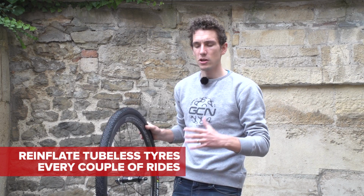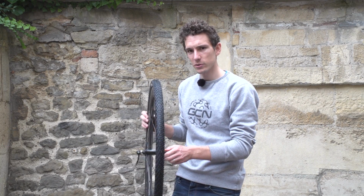Nice. Do bear in mind though that a tubeless tyre doesn't generally hold air quite so well as a standard inner tube tyre, so you're probably going to need to top it up every couple of rides or so, but hey, that's a small price to pay for no punctures.